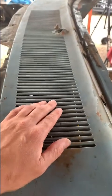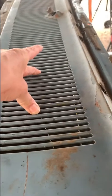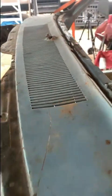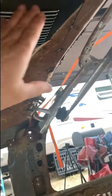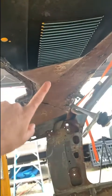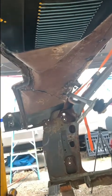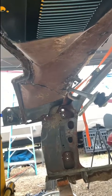But reality is, when it rains, this will now go down onto my feet. It's no longer over the engine bay. The engine bay starts about here. That's all under the dash. So I have to make a tray. So I thought, okay, I'll tack all that up, then I'll block this off here, and then I'll put a drain here, drain on the other side, down through the engine bay. And that's fine,